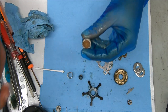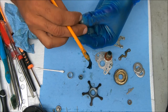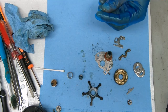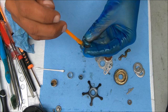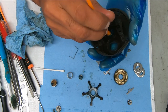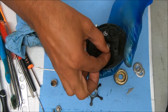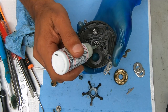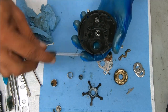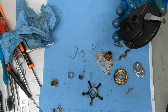For the tension knob we can just add oil to it, and I'm going to do a little bit of grease on the threads. Let's go ahead and stick our bearing inside here — I'm going to grease inside this hole even though it's a graphite body or side plate, because rust has a tendency to just sit and build up. Drop the bearing in, oil it, and work that in a little bit.